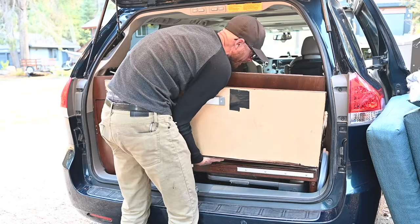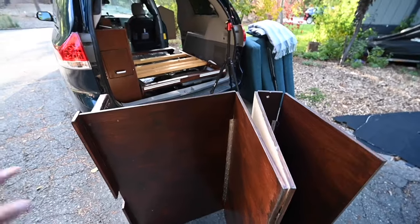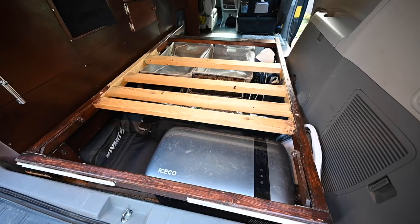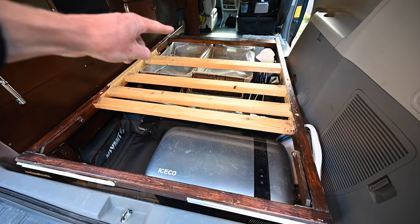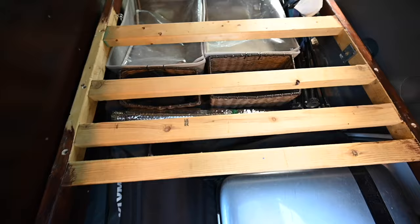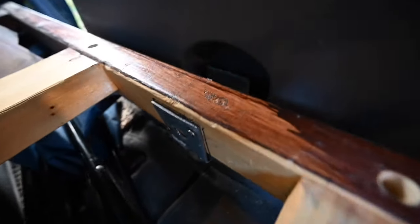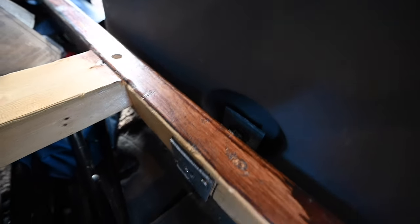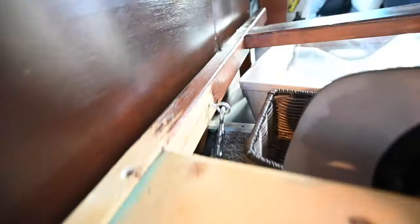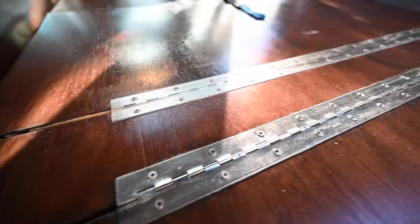Removing the bed base is a little heavy but possible. The front end here has front legs, the backrest, and a trunk flap. The general structure extends up in the corner, with two-by-threes and one two-by-four placed intentionally where the piano hinges rest. As for attaching the frame to the van, I took out the seat belt anchor and manufactured little metal pieces on one side, screwed that in to hold the frame, and on the other side there's a turnbuckle. Putting it back is just like taking it out — slide it in and put the carriage bolts down.